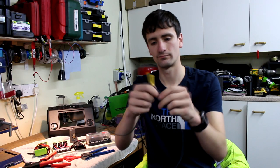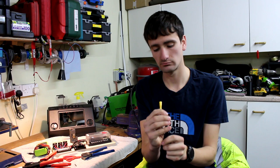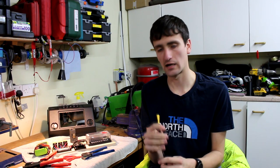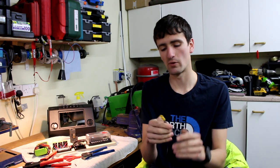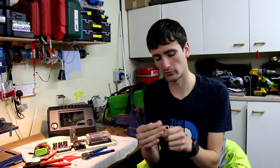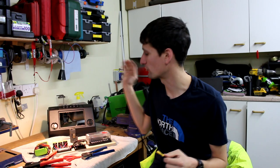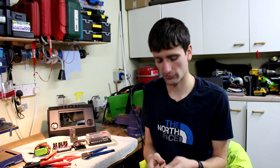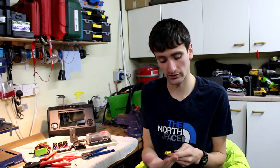However, connections like this have actually failed me, mainly because if you're using slightly thicker cable, over time it can work loose and fall out the bottom. I've had that a few times — nothing too drastic, it was mainly on the switchgear side, losing illumination on it or something along those lines. I don't daisy chain together anymore and I try to run separate earths for separate pieces of equipment as much as I can.